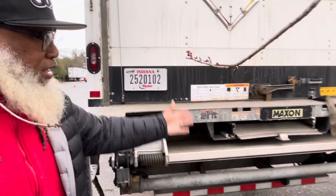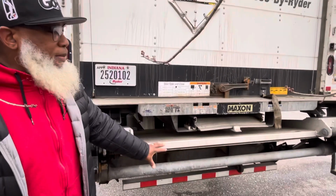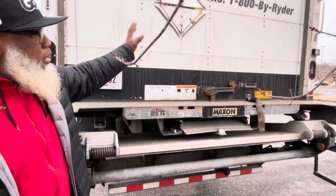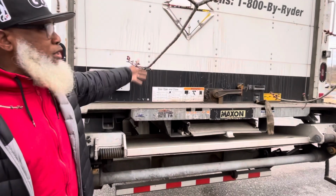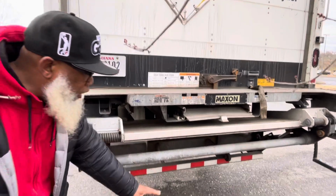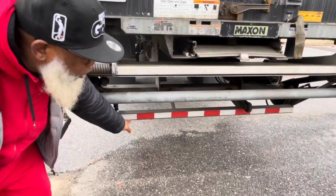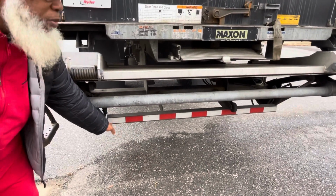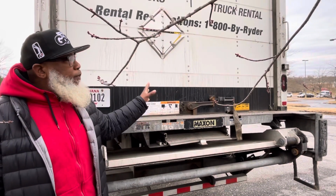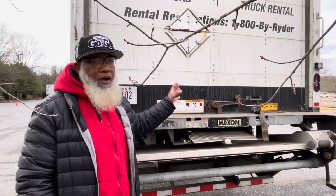If you happen to have a lift gate and a rear door, you can mention those. That's for another point. So the lift gate and the rear door, or tailgate door, is not cracked, not broken, and secure. No illegal welds, no loose or missing parts. And underneath is the DOT bumper, and that's not cracked, not broken, and secure. No illegal welds, no loose or missing parts. This concludes the pre-trip for the Class B vehicle.